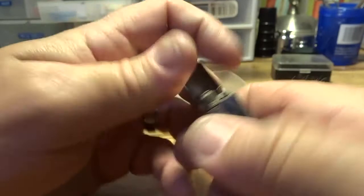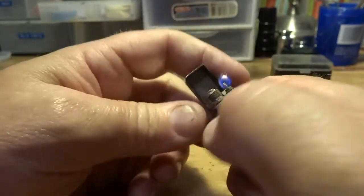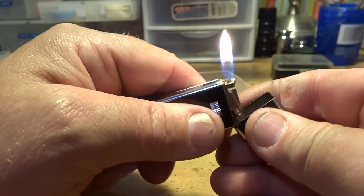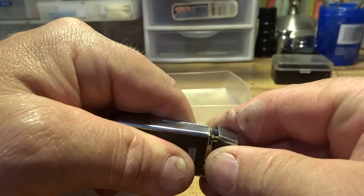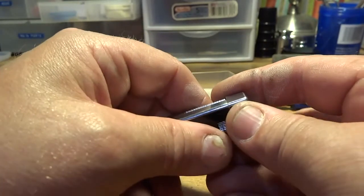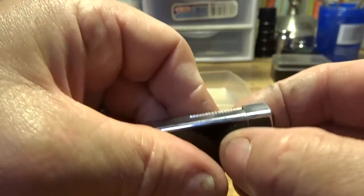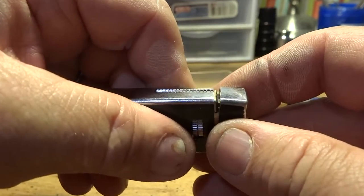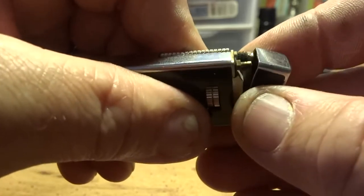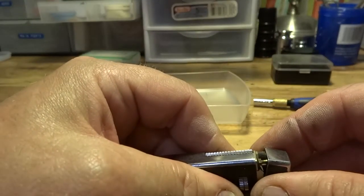Well, I believe that's it now. And what you want to do too is, after you get done this far, you still got another test, all right? And that's to close the lid slowly. Make sure the gas is shutting off. Another thing I do too is I'll turn this valve wide open, because you'll hear it when you crack the lid open. You'll be able to hear when the gas. Let me put it up here. Maybe you can hear it. I got the valve open. You can hear the little psst. Right there. About the same as it did last time. Yeah. It's opening up about right there, so you're good.